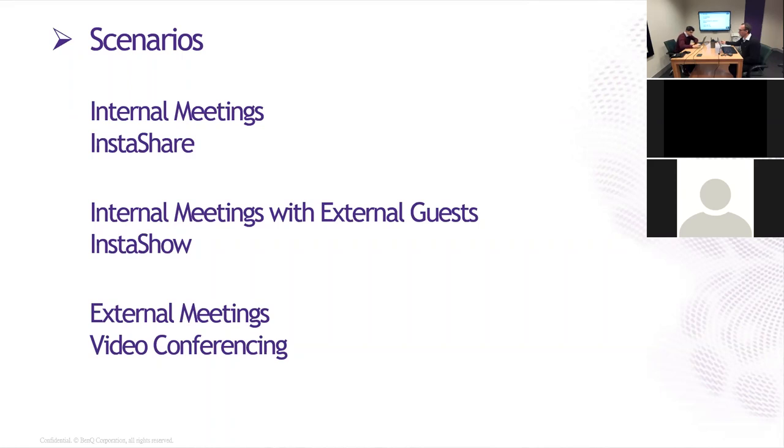Another one from Robin. Does touchback work with Windows/Mac wireless casting? So wireless casting, yes, for Windows only. Mac is a little bit finicky just because it's Mac. macOS isn't built with touch because Apple doesn't make touchscreen computers. You can install third-party drivers onto your Mac to get it to work, but it's nowhere near as easy or as fluid to use as a Windows OS. Usually what I would say to that, Robin, is Windows, yes, and that's where I would limit my response. So Windows, definitely.